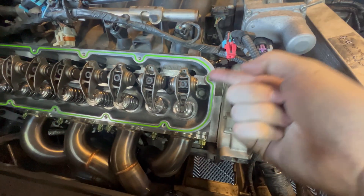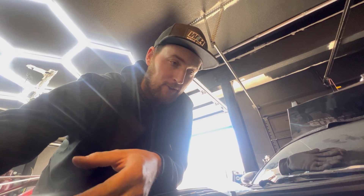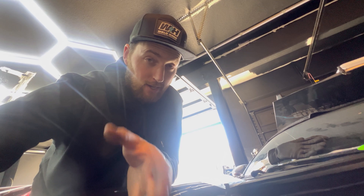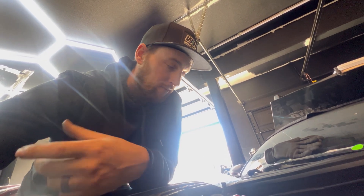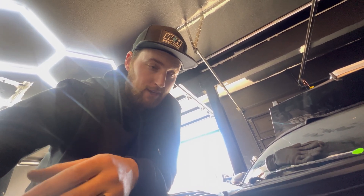I think this thing's going to be pretty rowdy. A couple things I learned: to do push rods, you have to measure them. You measure your push rod length with a push rod that unscrews and you set it. You can't just buy a kit off the internet — that's not how this works. You've got to measure this stuff out because you have to be within a certain window, which is like 5 thou. We have Johnson low-rise race lifters — it's hydraulic but only has a very small window that works. I learned a ton doing this because I've never done push rods or measured any of this stuff. Usually motor packages come to me sealed, so going through all this has been an eye-opener.